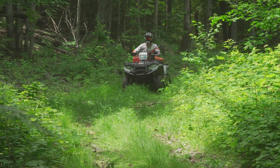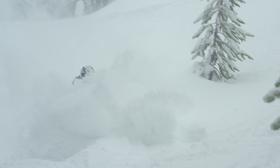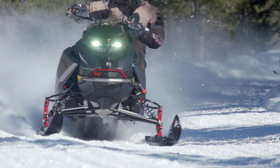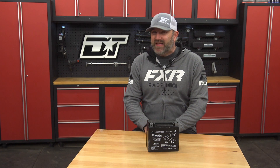This is one of the prime reasons most battery manufacturers don't offer replacement guarantees of more than about 6 to 12 months. It's interesting to know that any decent lead-acid battery is actually designed to last upwards of 8 to 12 years with proper charging. However, when was the last time you ever got more than three or four years out of a battery in your snowmobile or ATV? Usually it's more like two years.